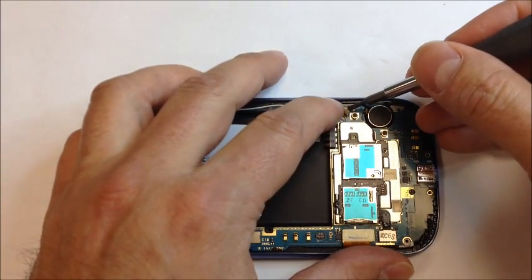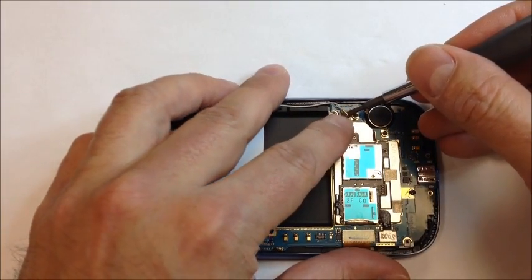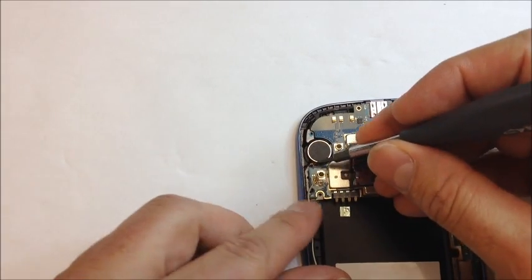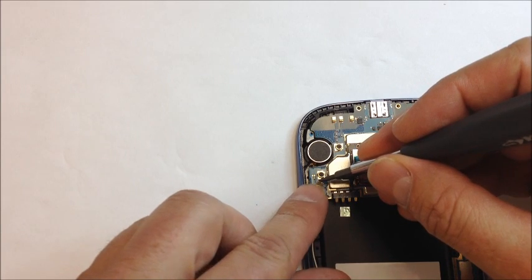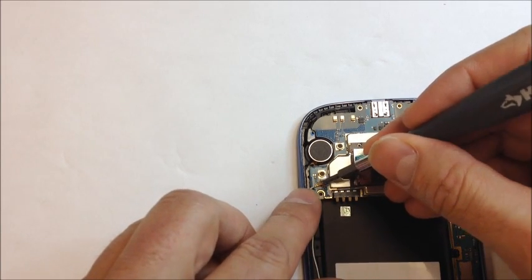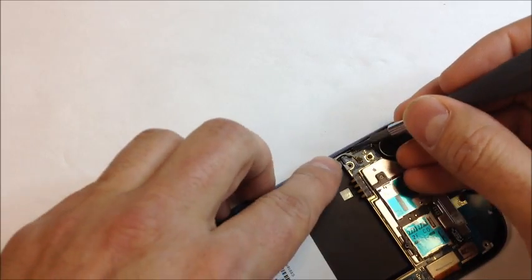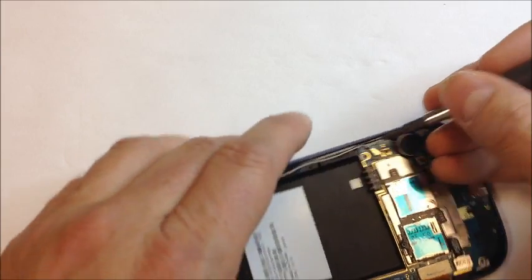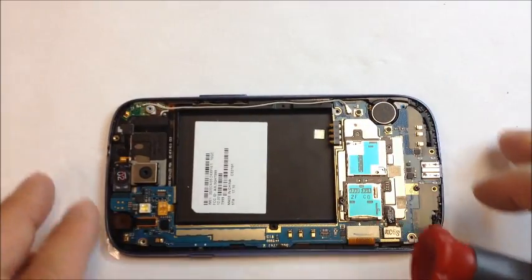The only thing you want to make sure — you can see I'm plugging the antenna wire in here. These are always fun. You want to make sure you route that through the little gap along the side of the board, so that you do not pinch those when you put the rear housing back on. Be really gentle with these — they can be damaged very easily if you force them on, so make sure everything lines up before you plug that in.